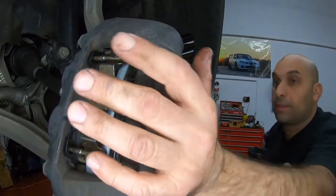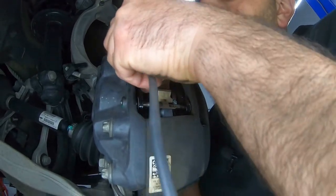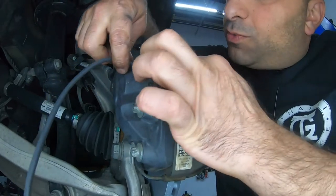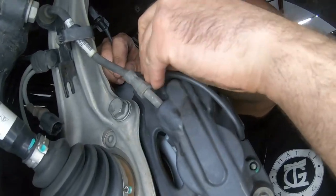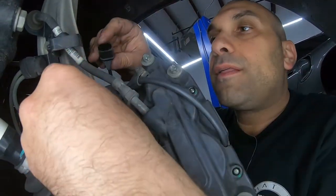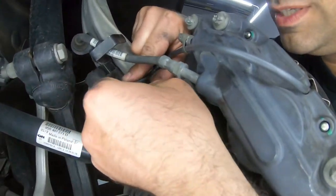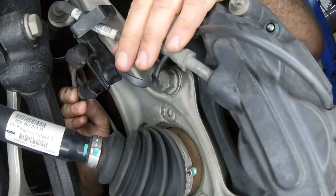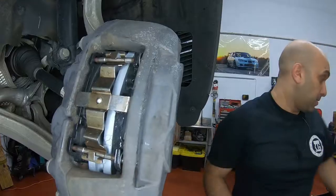And that's it. Now it's time to put in the brake wear sensor. You plug it into the caliper — the inner one has a little groove and you run it through. There's a little cut-out in the caliper; run it around. There's a rubber band that attaches to the bleeder screw. Then you plug the electrical connector in and turn the whole knob in until it clicks into place.